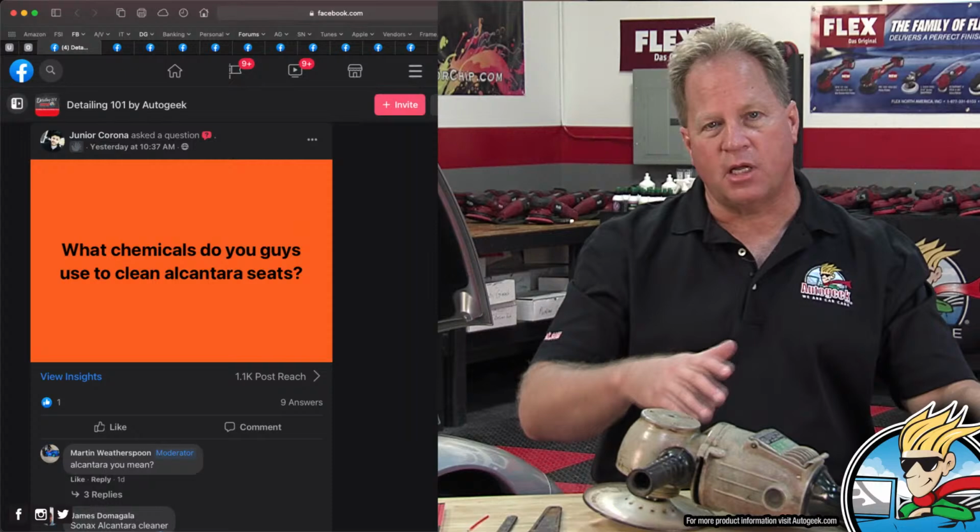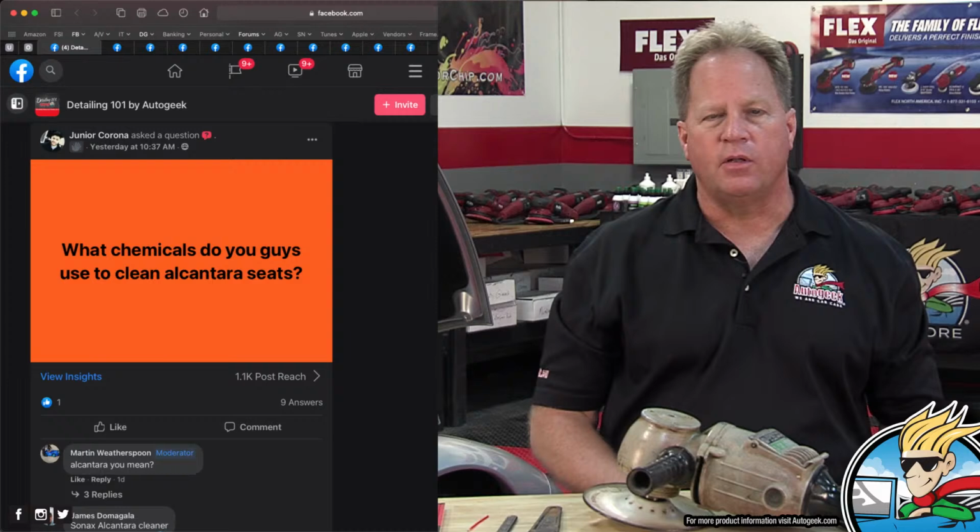He says, what chemicals do you guys use to clean Alcantara seats? One of the safest products out there is Sonax, which makes a product specifically for cleaning Alcantara. It comes in the form of a mousse. It has a pump head bottle, like a lady's mousse hair product, and when you pump it, it aerates into a foam. So the foam sits on the top, you agitate it. They actually make their own textile brush to gently massage that, then wipe it off. And that works pretty good.